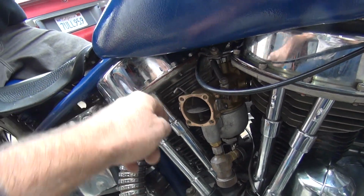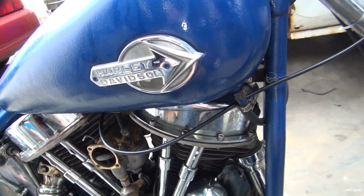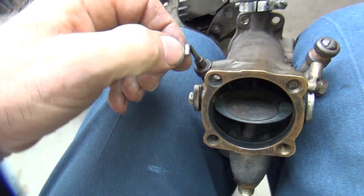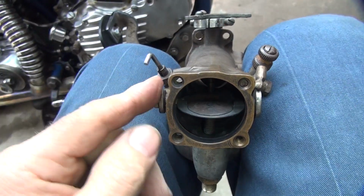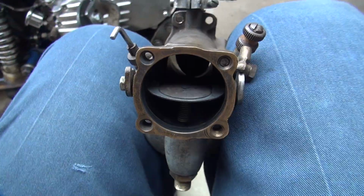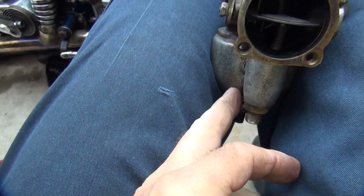Now, how far out was my carburetor we had to have the main jet at? I think it's like 6 clicks out from bottom. Yes. That's where my plugs were brown at. It's like 5 or 6 clicks. So this is where it was at before? This where you're running? Don't touch it. I was running right here. It was running here? Yes, sir. Okay, so we have 1/4 of a turn open. Yes. So you were pretty lean. With brown plugs? You're pretty lean on the jetting here. It's rich as hell because it's got the big jet down there.